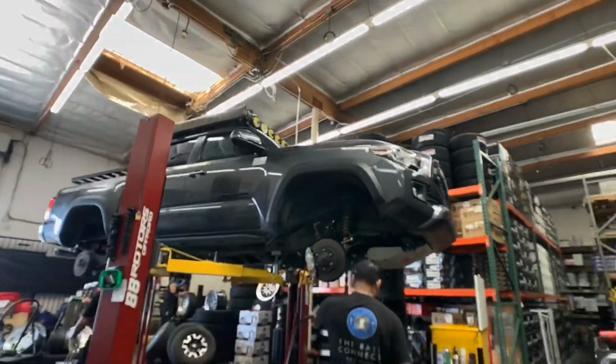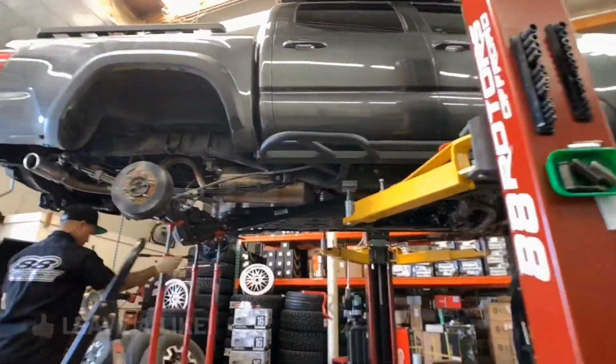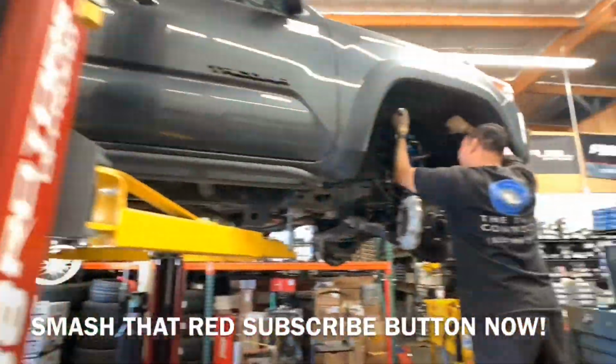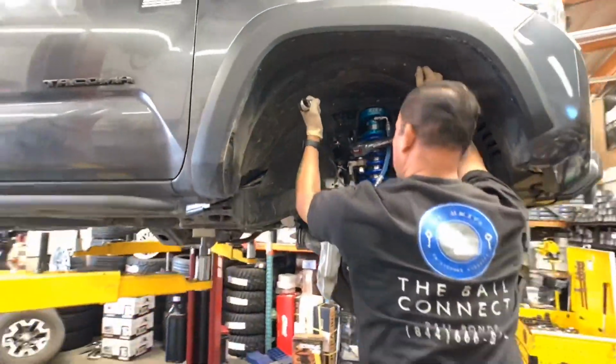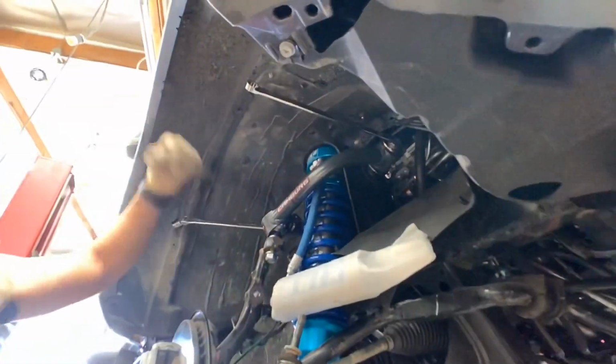We'll start off with the rear end right here. We're installing a Dakar EL095R medium load leaf pack on here. This one's also getting new ARB bushings, as you can see. For the front, we're installing the King's 2.5 remote reservoir coilovers with Camburg tubular uniball upper control arms. This one's adjusted to about 3 inches of actual lift height.